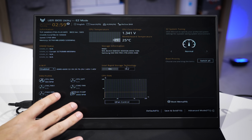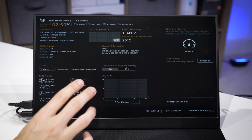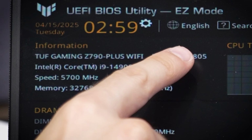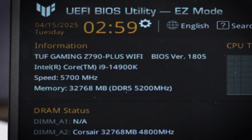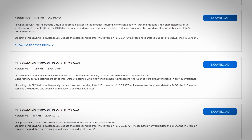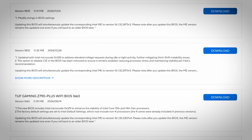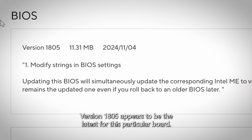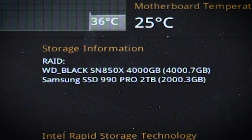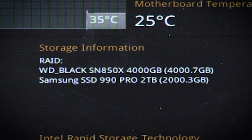Oh, should also mention, this is a sight to behold, because if we didn't have a correct BIOS update, it looks like this version is 18.05. I'll just throw up on screen if that's a relatively recent BIOS version, or if maybe it's an older one and the update that the owner tried didn't go through. The good thing is though, the board isn't bricked because it's consistently loading into the BIOS. There's no Windows partition installed yet on any of his drives because he hasn't had a chance to do that since the rig has been essentially bricked from the start.